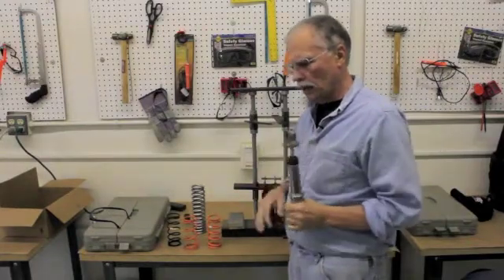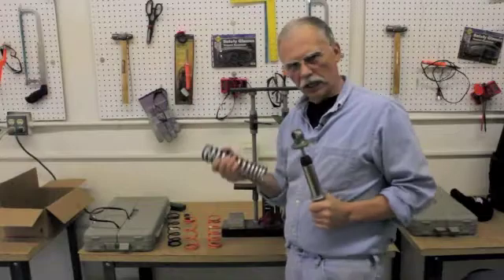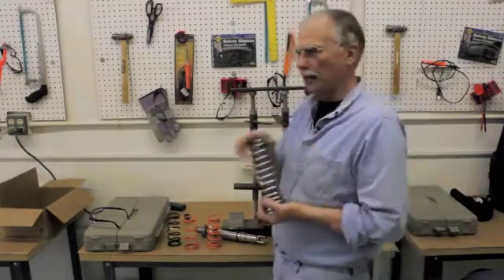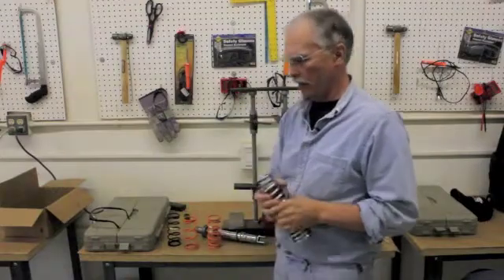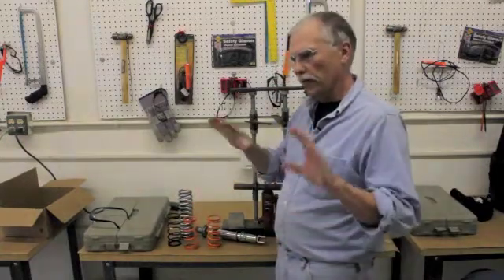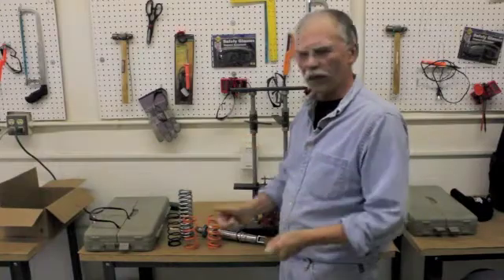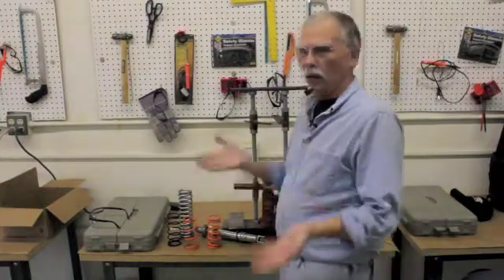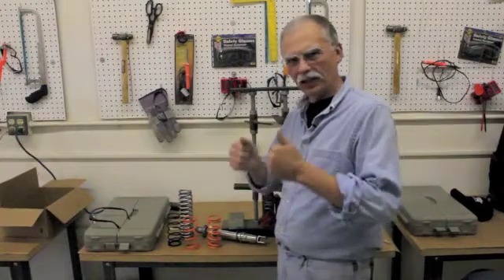Do it, but only do enough to settle the car and make it behave correctly. Young men tend to do two things that destroy the ride: they get the biggest, heaviest springs they can find because race cars use stiff springs, then they go down the freeway with their heads bouncing because the ride is so stiff. The other thing is cranking the dampening up too much — even experienced engineers have destroyed handling and started breaking parts because loads are being transmitted directly into the vehicle. It's all a question of Goldilocks: not too much, not too little, just right. That's really the essence of it.